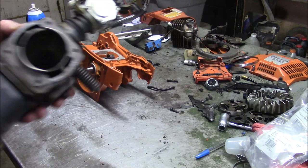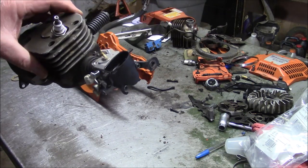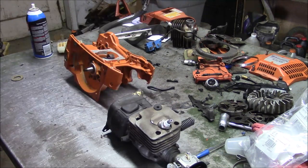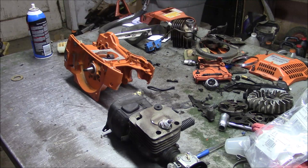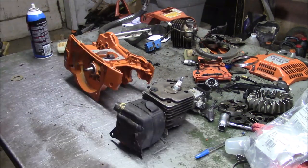And I'm not sure what I'll do with the carburetor, because that may over carburete the build, you know. Maybe not. It's got those little transfers, so it really doesn't flow as well, so it's not going to take advantage of that bigger carburetor as much. So I have a little bit of concern about just swapping that right in there.